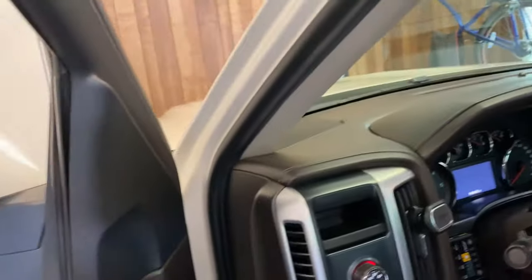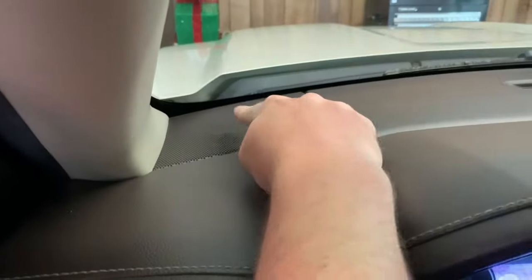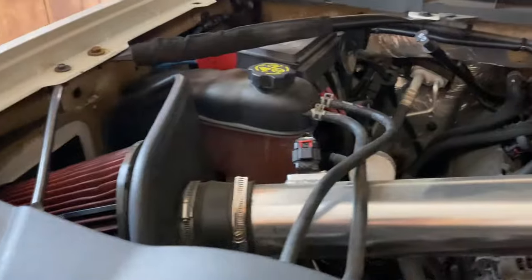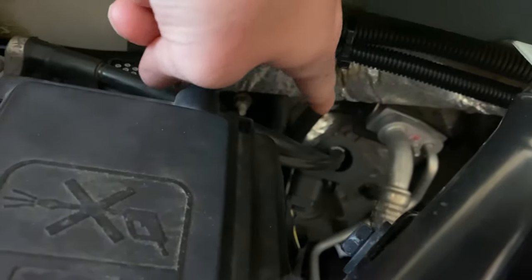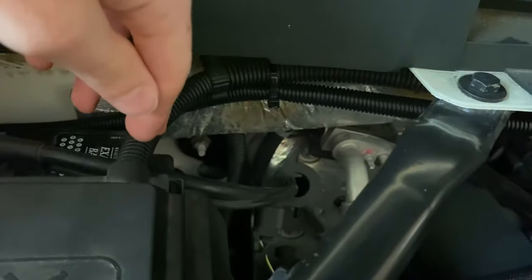I'm going to go ahead and figure out the best way to fix this issue. Supposedly there's a ground up here — it's like a G218 — and there's a problem with that that makes the ignition trip, because that's the ignition ground. I'm also going to disconnect the battery. There might also be a ground somewhere down there having an issue, because there are two grounds off of the battery, and the second one goes down to the body of the truck and could be covered with dirt and buildup from years.